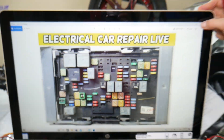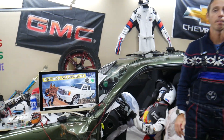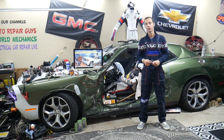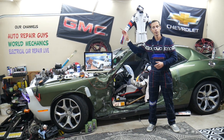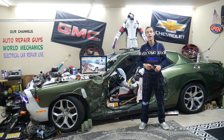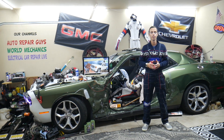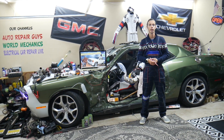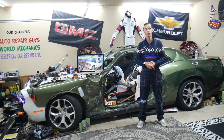Other things that can easily cause the ABS light to be on: it could be a bad brake light switch — if the brake light switch is bad, your ABS light could be on. We have videos on our channels on how to test the brake light switch. It could also be a bad ABS sensor, also known as a wheel speed sensor. You have 4 ABS sensors, one on each tire, and it detects how fast each tire is going. If one is bad, the ABS light will be on.